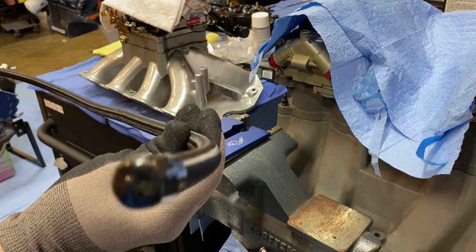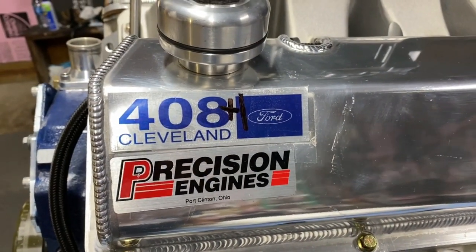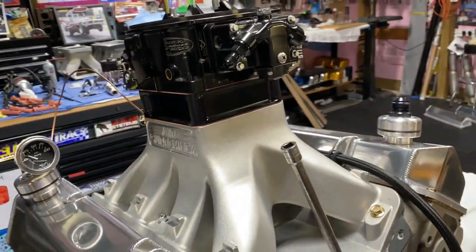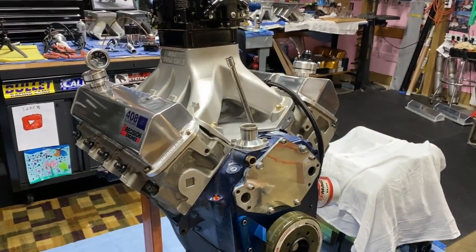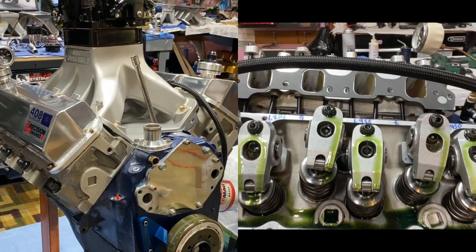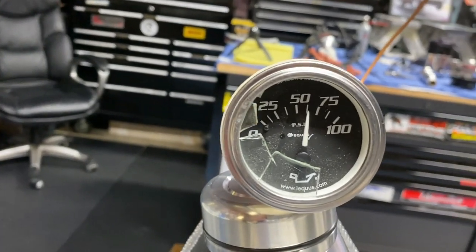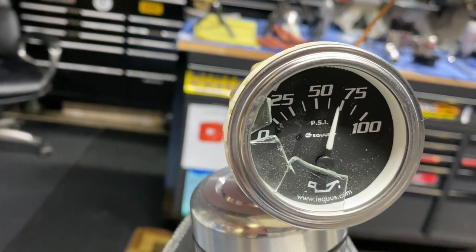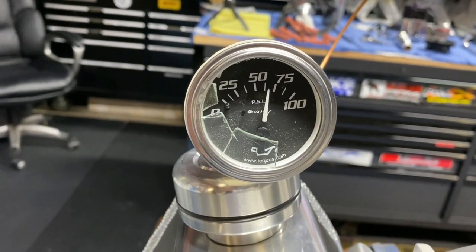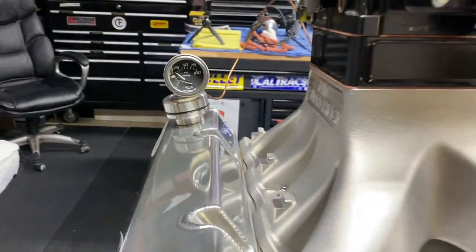Stay tuned — you'll see the final product installed custom at the Drag Boss Garage. Here it is — the 408-plus-one, 409 cubic inches. She's all done. I'm just priming it up. I made sure I had oil coming out of all the rockers before I put the covers back on. Tristan Trickus always said he never let an engine leave his shop without oil coming out of the rocker arms. Let's see what she does for oil pressure — she's got almost 75 pounds right there. I'll have to look back and see what I had before — almost 75 pounds of oil pressure, that's plenty for this old girl.